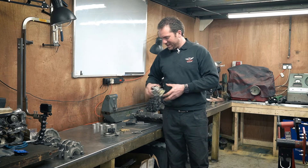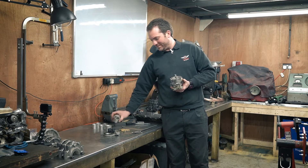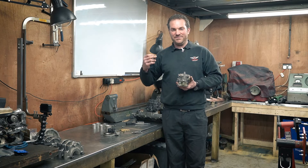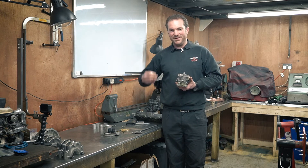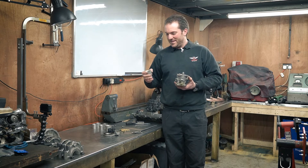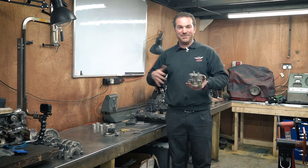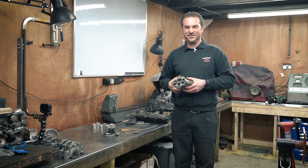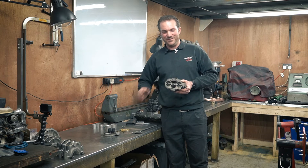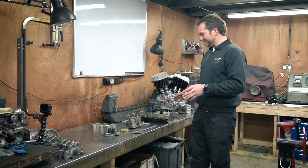On my car I have a 48 IDA and I put in a quite large 41mm venturi, then kept going up on fuel mixture jet sizes until I was pretty much maxed out - something like a 2.6mm fuel jet. Then I tried using a smaller venturi to see how much effect it had. It actually had a huge effect - I lost about 15 horsepower. So it's well worth going as large as you possibly can if you're out-and-out racing.